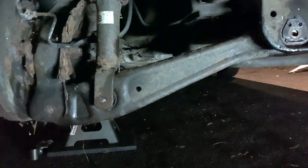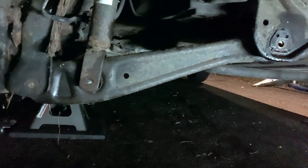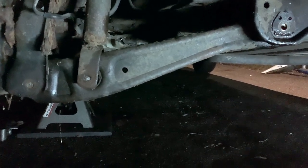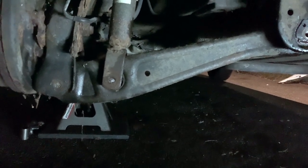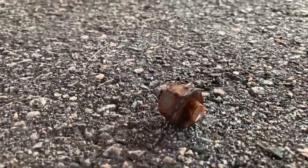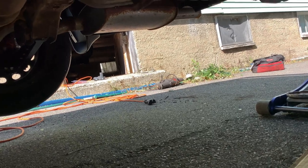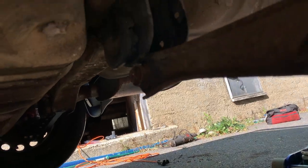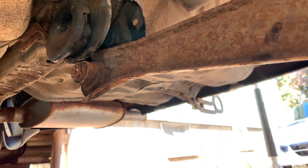This really sucks. It slowed me down greatly. But we'll pick up some cutting wheels for the grinder and then get this sorted tomorrow, if not the following day. But using YouTube magic, we'll be cutting that off now. That's the bad one there. Bad control arm there. Anti-seize, people. Routine maintenance: every time you take a bolt out, grease it, anti-seize, just so the next time you gotta do this, or be courteous to the next owner.